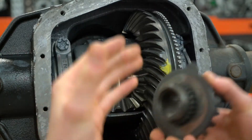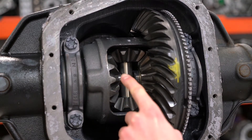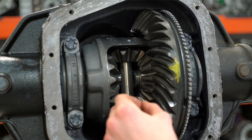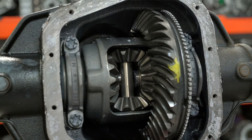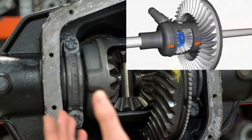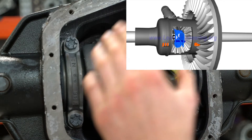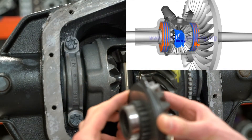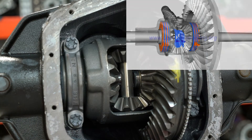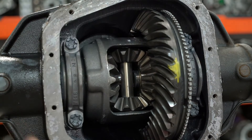So when they mesh, it will lock together when there's enough pressure on them. There's preload on these clutch packs from these curved steel discs that are in here, unlike the animation where there's a preload spring right in the middle, but it does essentially the same thing — meaning it puts pressure, preload, on the clutch discs, allowing them to turn as one unit if the thing's in the air, like that Corvette where you turned one wheel and the other wheel went in the same direction.